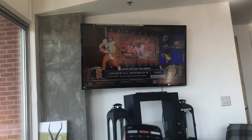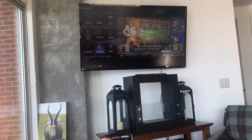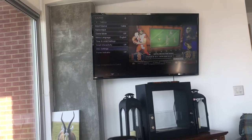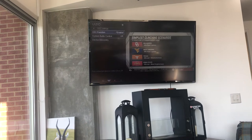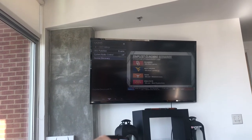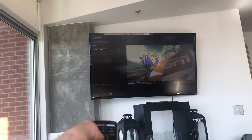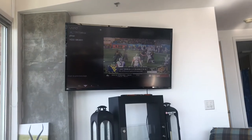Now, a couple other critical steps. On your TV, the CEC settings have to be turned on. I'm going to go into the menu — for me it's under Settings, not under Audio — and flip down to where it says CEC. CEC can be called different things on different TVs, but on Vizio they appropriately call it CEC. I've already enabled it — default might be disabled. I have system audio control off, and you're going to have to hit device discovery at least once. That's going to find the Google Fiber box but also the Vizio sound bar, which is how the ARC system ensures they're communicating.